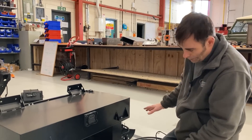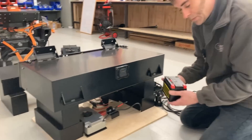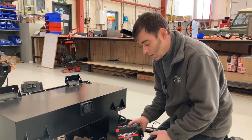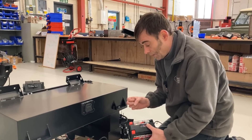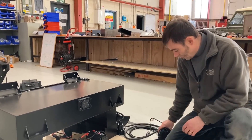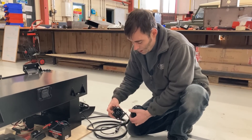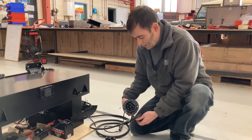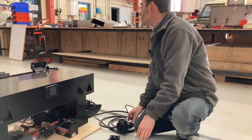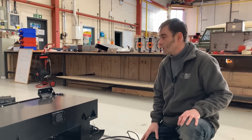Around the back here, you've got your 12-volt battery and your DC-to-DC converter. This is a lithium battery — nice and light, small little 12-volt battery. The reason it's so light is because you don't need to crank over a starter motor; all it needs to do is basically fire the contactors on when you turn the key. And over here we've obviously got the charge socket — two types of charge sockets because this is going to the States, so this will need the Type 1 charge socket. The test loom here is for a European market, which is a Type 2 charge socket.